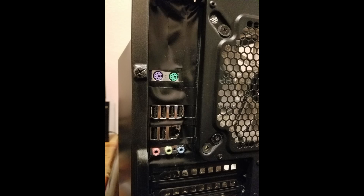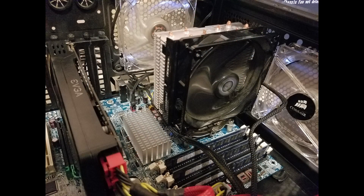What I found on eBay when I started looking was an HP Z400 workstation setup. It's similar to how a server setup would be, but it uses similar components and is designed for a desktop — it was a full ATX desktop setup. It didn't come with the backplate so I had to get a little creative there, and it also didn't come with the cooler. Fortunately I had a Hyper T4 from the pre-existing system that I had put together for my little brother that was able to transfer over, no problem.